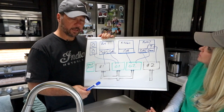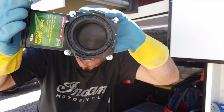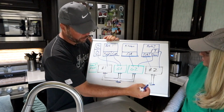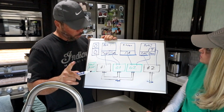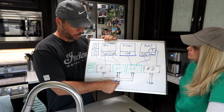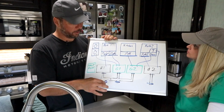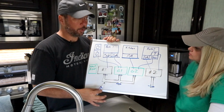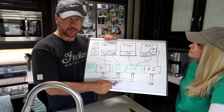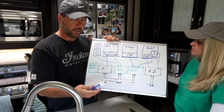So when we're boondocking, what we did is we got some Valterra valves, which are a good idea even if this trick doesn't work for you. You put a valve here, and you put a valve here. This has 2 benefits. One is that when you go to set up camp and you unhook the cap here, you'll almost always get some gray water, we hope it's gray water, running out because it settled while you were driving. Stuff that was in your pipes settles down and then dumps out. So if you put one of those Valterra valves here and keep it closed, you can hook everything up and then open it up when you're ready.